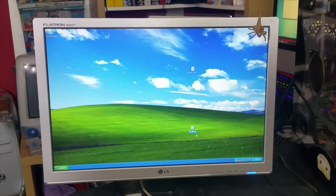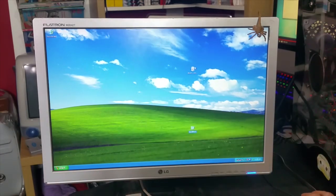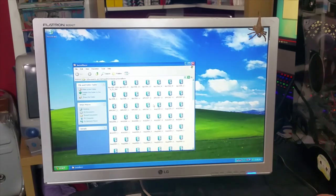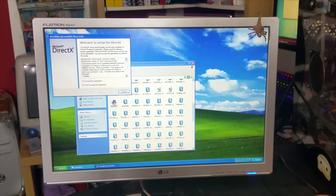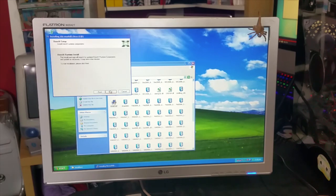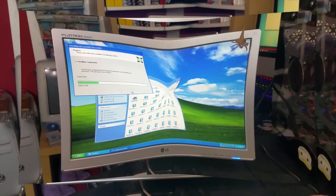Right, I tried a couple of ways and they all went wrong. So eventually, I went online and followed some instructions in a video and basically, you create a folder on your desktop, then you drag across the file you've downloaded, the June 2010 redistributable. You extract it into there, and then once it's in there, somewhere amongst all the files, you find DXSETUP. There we go. I accept. And this should have us running DirectX 10 in no time. I'll be back once it is.